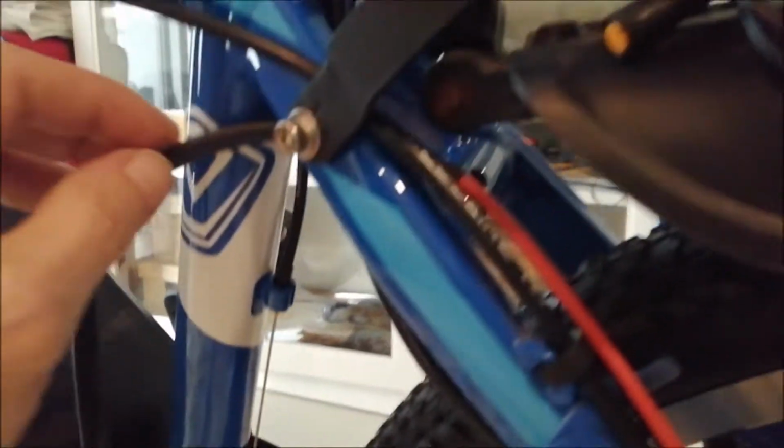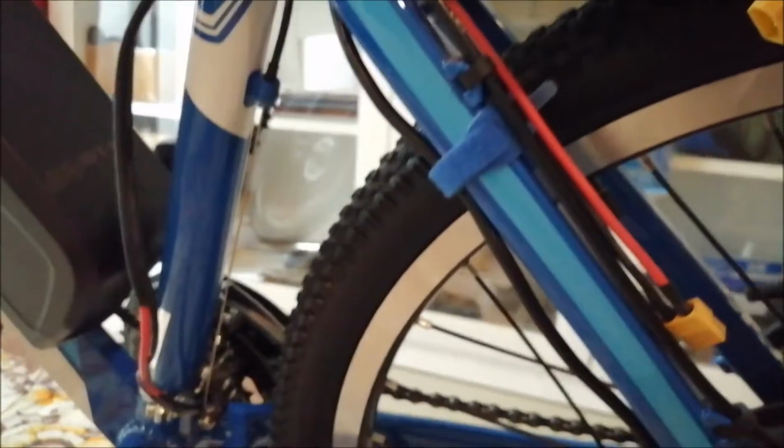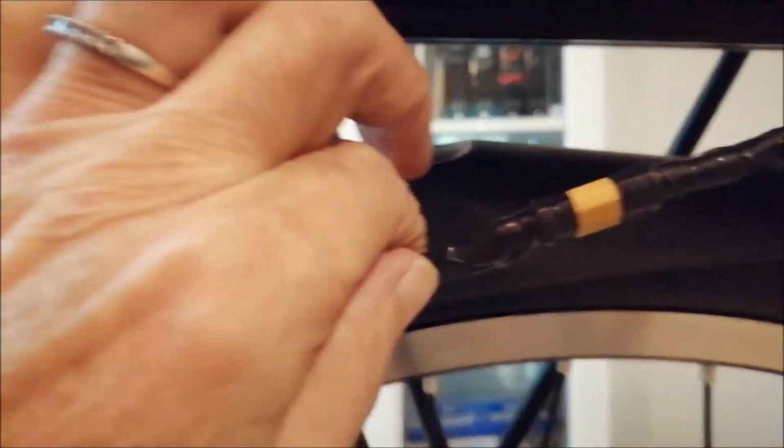As you can see, here is an XT60 connector on both sides. So I go ahead with insulation tape and tape the bare cable off. This is firstly a rub protection, so that it doesn't rub through. Secondly, it keeps the water from going everywhere. And I will cover these two up, because I don't need them because of the XT connector, only if I have to disconnect the controller itself. Normally never. Yeah, so I put insulation tape and route it. Then it's on to the next step. As you can see, I insulated the cable, also around the XT connector, so everything is nice and tight, but you can still open and close it nicely.